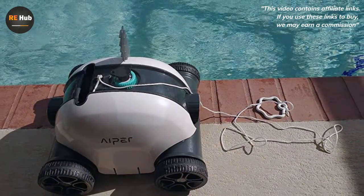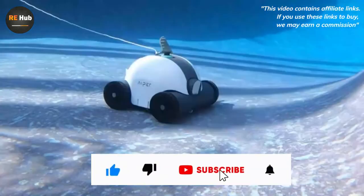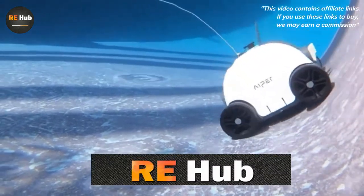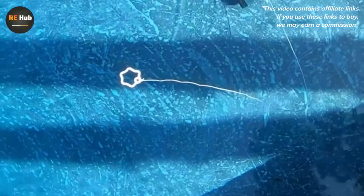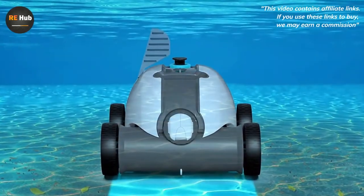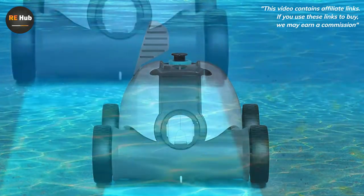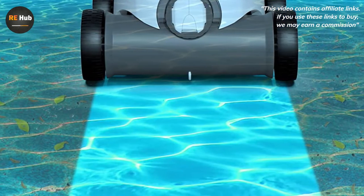There are two locks that hold the top doors closed — slide those to the unlocked position to open the top. Inside, if you remove the debris baskets, you can see a foam block. Two of these are installed and two extras are provided. When you first use the Seagull in your pool, if it's not surfacing properly to reach the top of the walls, you may need to install one or both of the extras on the underside of the center beam for extra buoyancy.